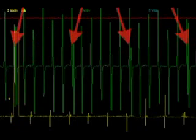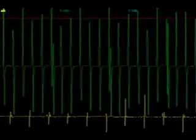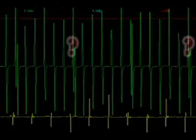One engine revolution occurs every 6 crankshaft signals. The double crankshaft signals are the synchronization to mark the beginning of a revolution. They are marked with red arrows. Monitoring the scope pattern reveals the camshaft signal will occasionally fail to produce the squared pattern expected.